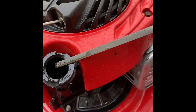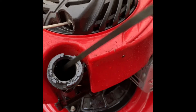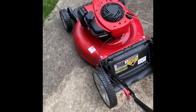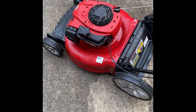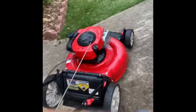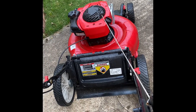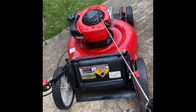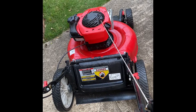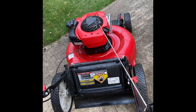So other than the blade adapter, I'm going to go ahead and just empty out half this oil and see how it goes. You saw that the oil that was in there was way too high — probably over a quart over. I've lowered it to the right level now, but when I go to try to pull this cord, I can't. I bet this thing is hydro-locked. To un-hydro-lock one of these, you've got to take the spark plug out and then pull the cord until all the oil gets out of the cylinder.